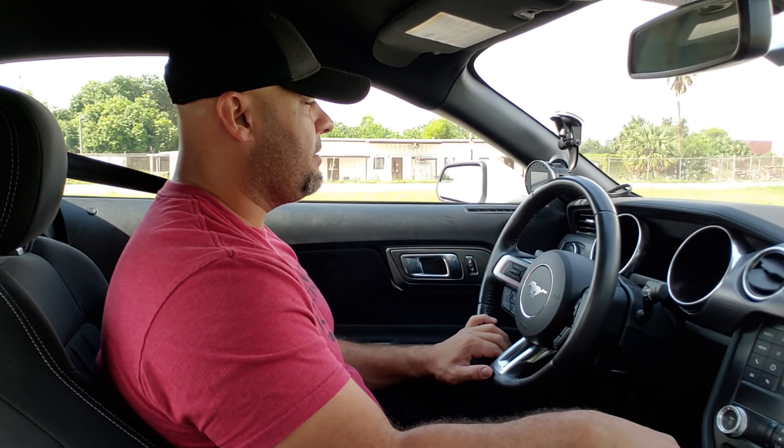Short-term fuel trim right there — plus or minus five percent. There's a bit of a lean spike because I was on and off the gas, so I'll take my next set of logs to be a little cleaner. But right here when my foot got calmer, short-term fuel trims were only correcting about five percent. Over on the wide-open-throttle section — right click, drag, zoom in — look at how tight short-term fuel trim is through that pull: three percent. Beautiful. Timing is 16.5 degrees, knock sensors negative the whole pull — never went above zero.